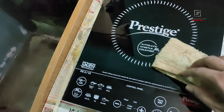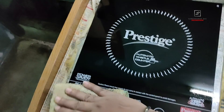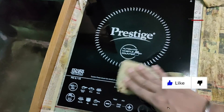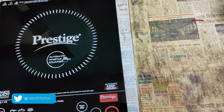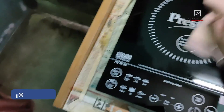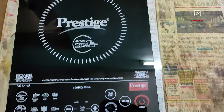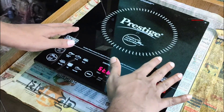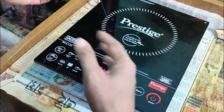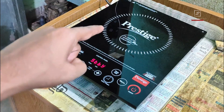The cleaning process is simple. After cooking is done, first turn off the power. Give the glass surface at least 30 minutes to cool down completely. Once cool, take a soft wet cotton cloth or small soft towel and gently wipe the glass surface throughout. Then take a dry soft cotton cloth or towel to wipe away moisture until the surface is fully dry, then leave it in air for a while. Always ensure the glass surface is at room temperature before cleaning — cleaning with a wet cloth on a hot surface can break the glass. If there's any spillover during cooking, wipe immediately with a dry soft cloth; never use a wet cloth while in use.